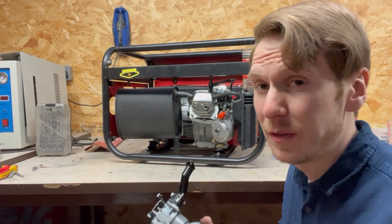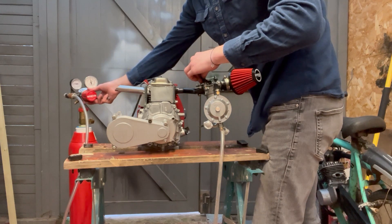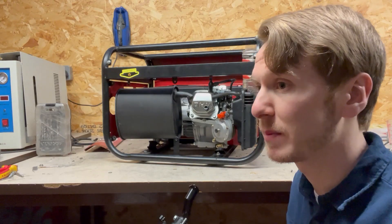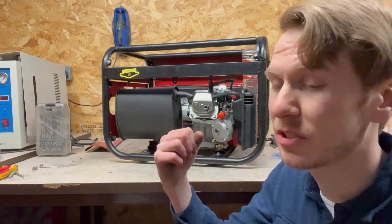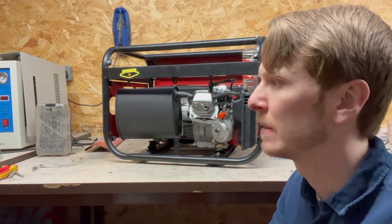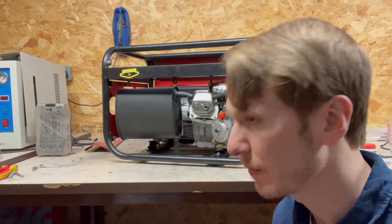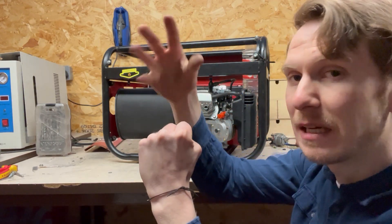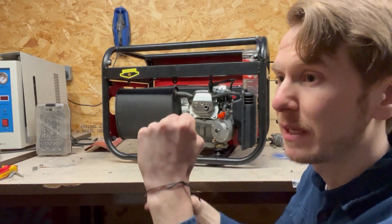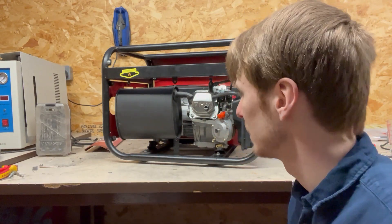In fact, if you watch the video where the 50cc engine came to a complete stop and died straight away — I believe that was because of excessive piston slap. It actually smashed the spark plug to bits. That excessive play of the piston inside the engine is all down to timing. When the spark fires too early, you have all that force from the piston traveling upwards, the hydrogen detonates, and all that force is trying to push it back down before it gets to roll over. The only thing cranking it over at that point is the extreme pressure generated and the flywheel — not good for the engine at all.